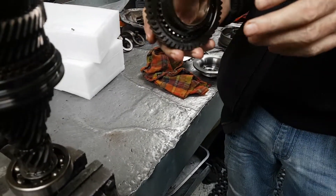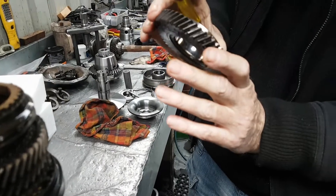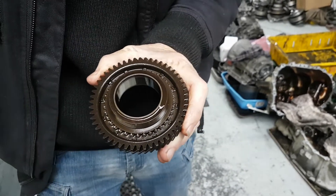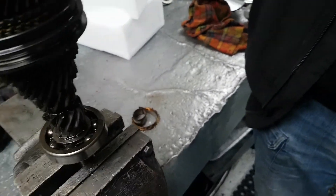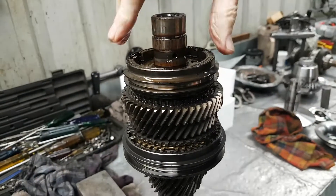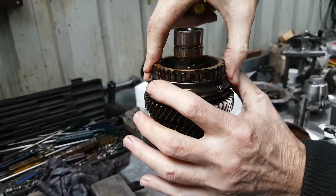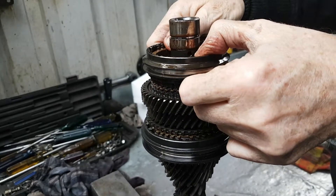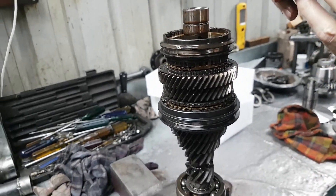This is sixth gear. If you look down to where that's touching — that's your slider. I always thought that was called the synchro ring, but that is the synchro ring and this is the slider, which will actually overlap and engage it. This is fifth gear here, and when I push down and come back up this way, that engages the synchro ring into sixth gear.